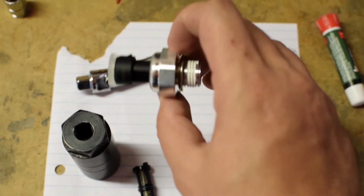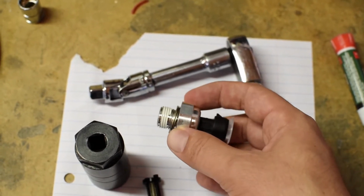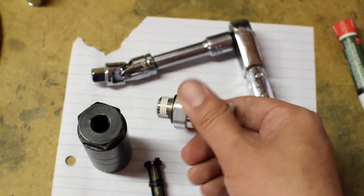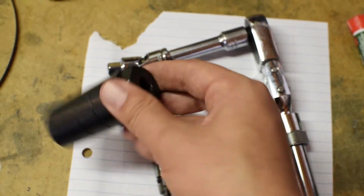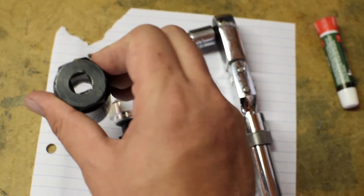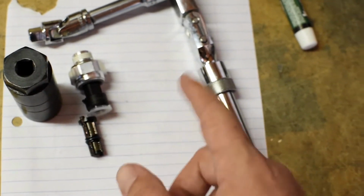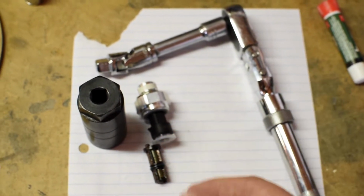Okay, so here's the oil pressure sensor right here. It just threads in. It's kind of tricky. It goes in back behind the engine block and the firewall. This is a Lisle 1 1/16 socket, half inch drive. It's specialty just for this job. You'll have to order it. I'll put a link to everything I'm using in the description below.